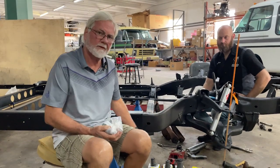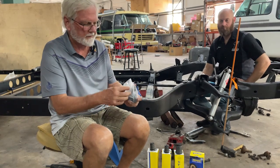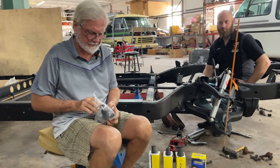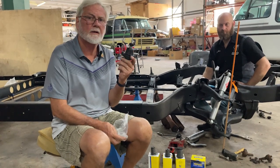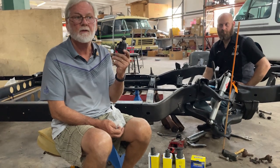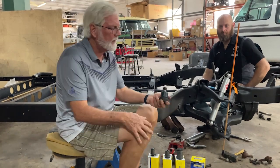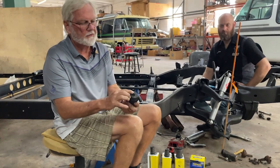All these that I'm going to show you in a minute are all in Moog boxes. This one isn't — this is a lower ball joint. Applied GMC and Jim Kanemata had these made for us. There are about 500 of them made, so we have 500 ball joints left in the community. I'm going to put a ball joint in — it's got a bolt on each side on the wings, and it's got a big nut here.